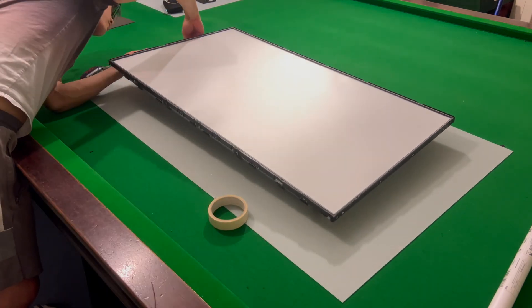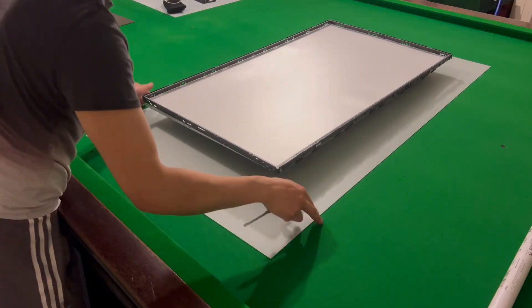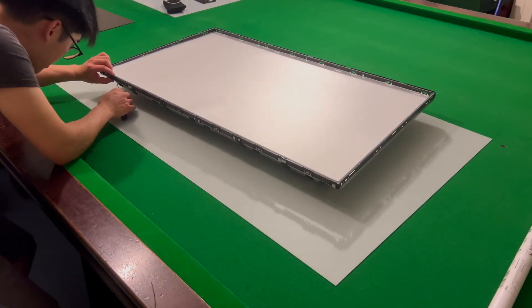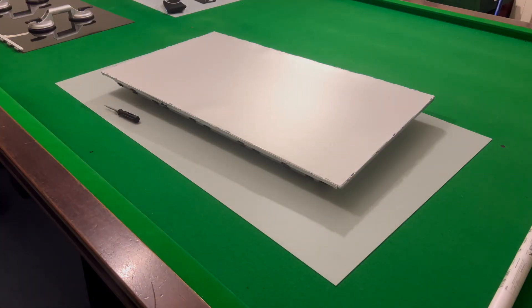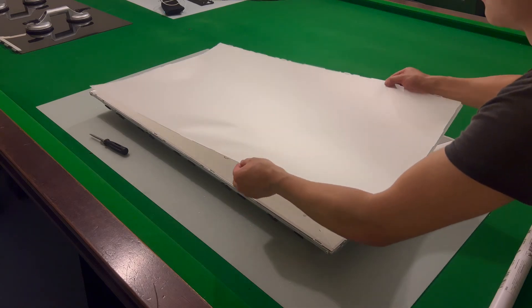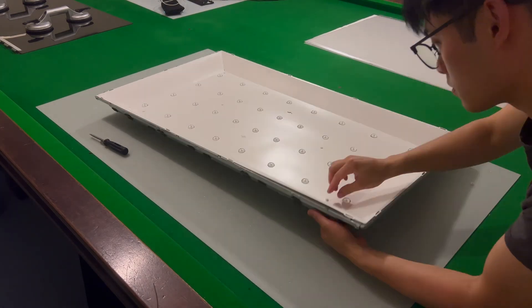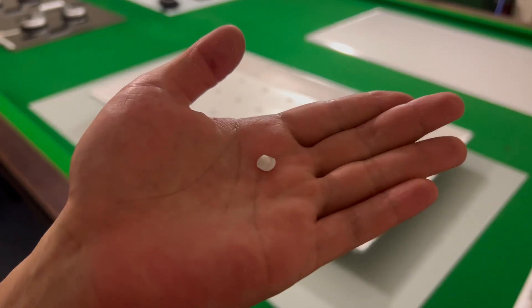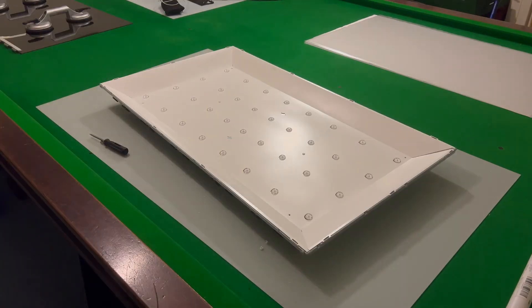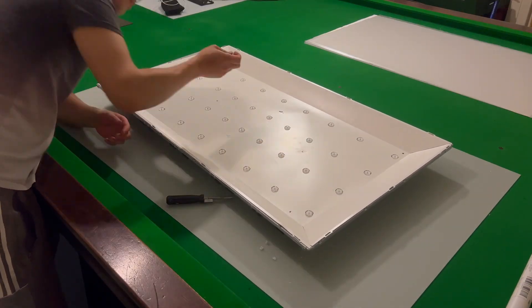There's now another plastic frame and some light diffusing sheets. We remove the plastic frame by using a flathead screwdriver and prying against the tabs that clip in place, which will give us access to the LEDs. The light diffusing sheets lift right off — be mindful to keep them all in the same order. There are some press-fit clips holding the white reflective sheet on, so I'm accessing them from behind and pulling them out.